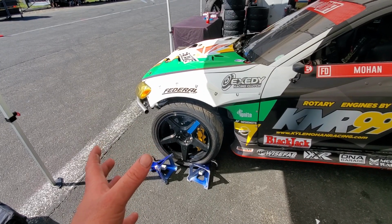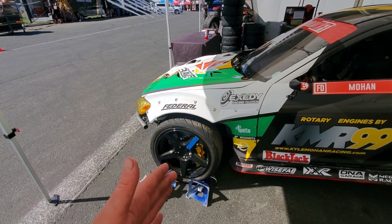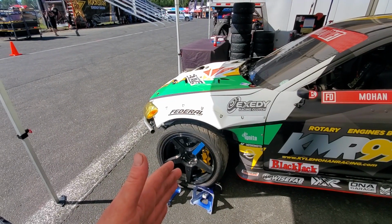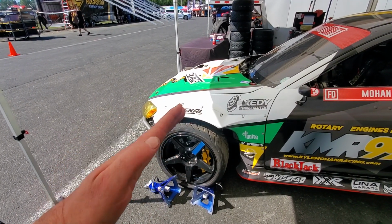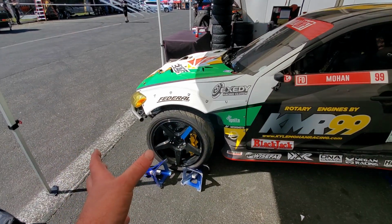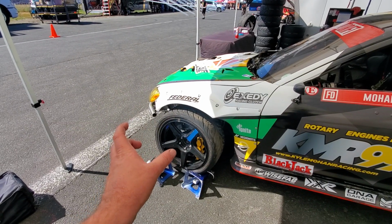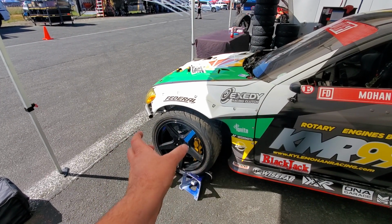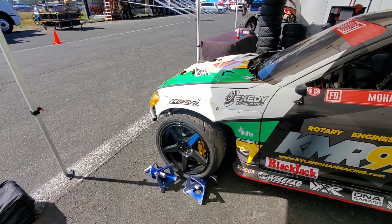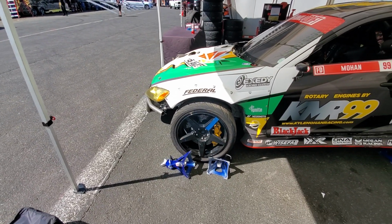And as far as what a lot of people are concerned about, steering return, I forget what it's called, but basically how the tire is going to return in your steering, it's actually built into trail. So they've moved the hub back, so essentially the steering feels like an OEM car returns, but it's just done a different way.